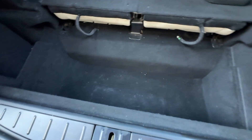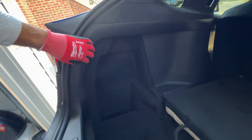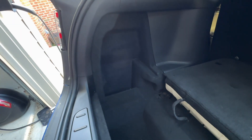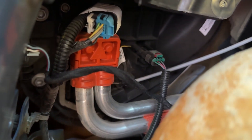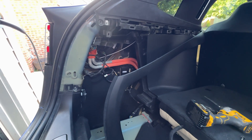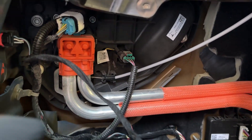Got to remove some stuff from the cargo area. The service menu says you should clear everything out, but I'm going to do the path of least resistance — just get whatever I need out of the way to get access to the charge port. As I pull back the carpeting, I can start to see I'm heading in the right place. I'm going to go ahead and remove this carpeting very carefully without breaking anything, and now I have unfettered access to what I need to pull out, which is that charge port.